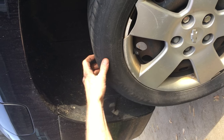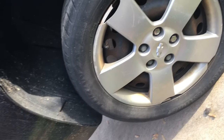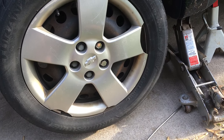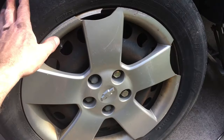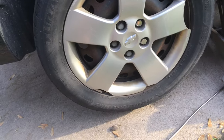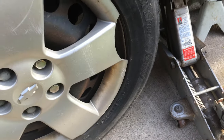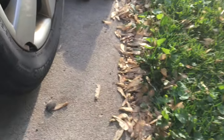The symptoms of this are basically my pedal is a little bit weak. You get your pedal from the rear drums and your braking power from the front disc brakes. So we're going to go in the back and adjust them. As I'm adjusting with the clicks, my assistant's going to be spinning the tire, and we're going to make sure it takes fewer revolutions than it did starting out. Let's get underneath the car and get this thing a little bit tighter.